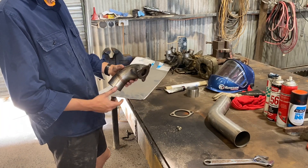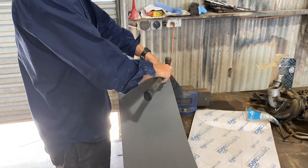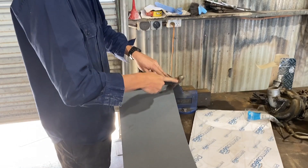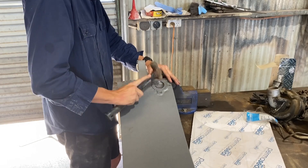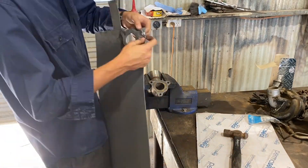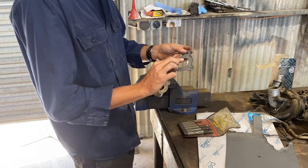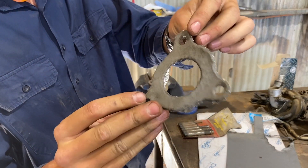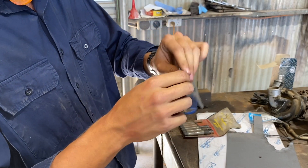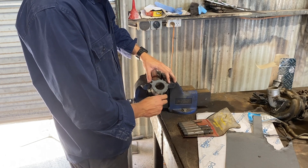So we're going to have a crack at making a gasket for the dump pipe. It does get a bit tricky because there is a layer of steel in these gaskets — I'm not sure if you can see on camera. There is a bit of steel in there that does get a bit tied up when you're trying to cut it, but it wouldn't be a very good exhaust gasket if it didn't have that in there. So you've just got to work with it as best you can. I think it'll work quite well, a hell of a lot better than no gasket at all.